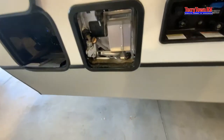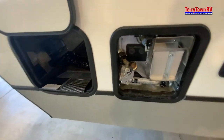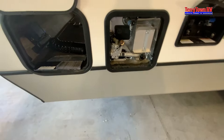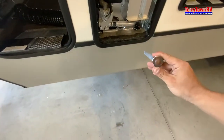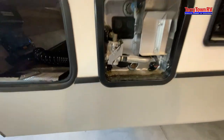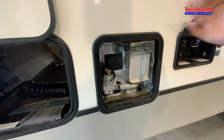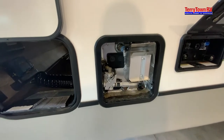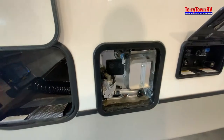Going back to the water heater — after you plug in your water, the first thing you're going to do is go inside the camper and turn on your hot water line. You're going to want to push out all the air that's in here and fill it up with water. Take your 1 and 1/16 socket, tighten down the drain plug, then go inside, turn on your water, and you're going to want a good flow of water coming out of your spigot because this needs to fill up before we turn the button on inside. You can also make sure it's full by pulling the pressure release valve — a little water will come out if it's full.